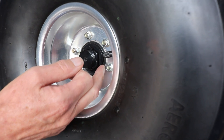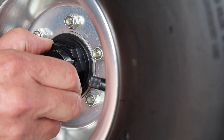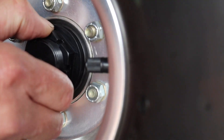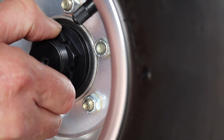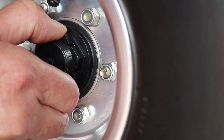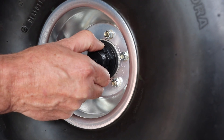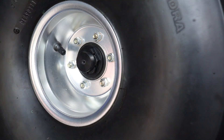This rubber piece just outside the flange is rotating with the wheel. To set the preload, you merely have to put enough pressure on there so that as you rotate the wheel, the seal doesn't rotate any longer — and you can see that's happened right there. Now the preload is proper, the wheel is rotating, the seal is staying stationary. Put the cotter pin in, and you're done.